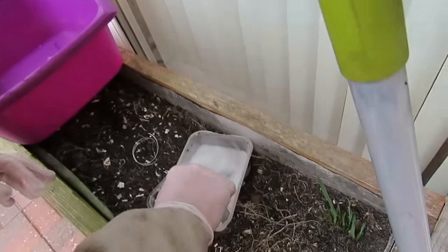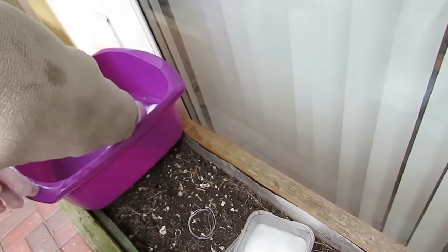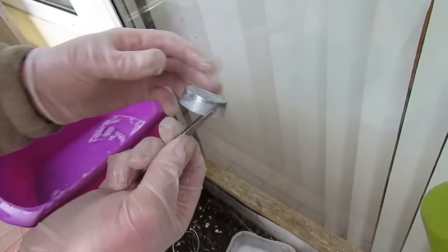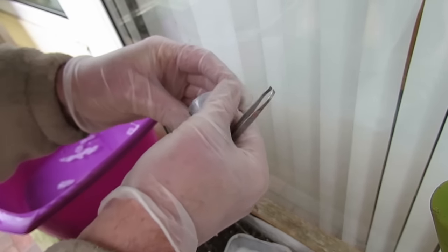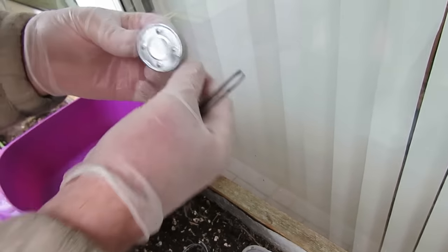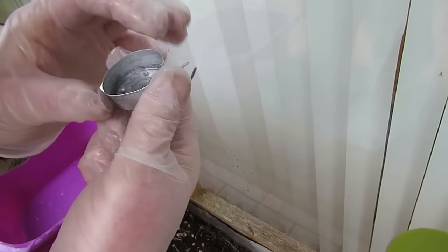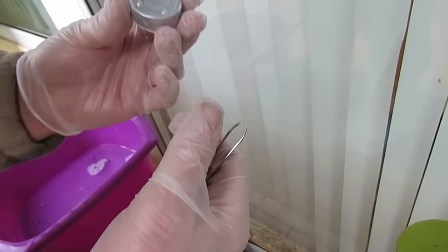Now we'll have a look at the pot, which has been in for about 2.5 hours. Again, a little bit of oxidization, but a little bit of a wipe over, and you can see there's no evidence of it eating into the plastic, eating into the aluminium. So it causes a little bit of oxidization. So on an aluminium manifold on a vehicle, it's going to do absolutely no damage if left in for a couple of hours.